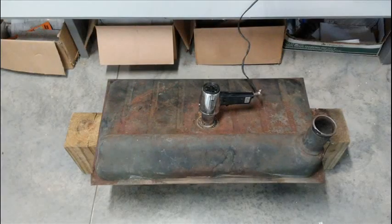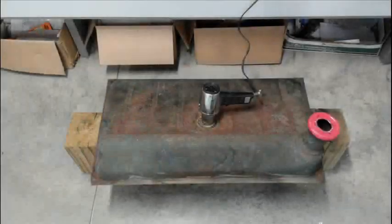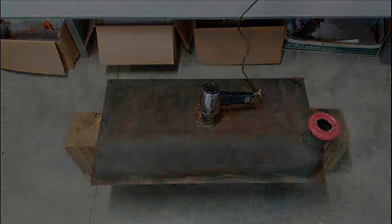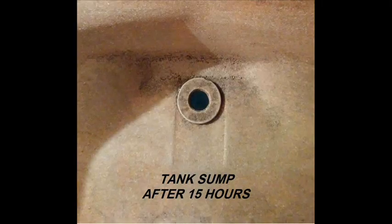After 15 hours I drained the tank and washed it out several times with hot water and Dawn dishwashing liquid. I then used my heat gun to dry the inside of the tank, placing it in the gas gauge opening and using a restrictor on the gas filler port to slow the exit of hot air and help carry water vapor out of the tank. The next three photos are after the electrolysis process and tank drying were completed — it's much cleaner with very little signs of any rust left in the tank.